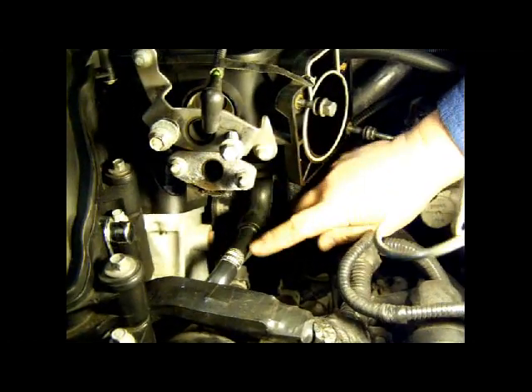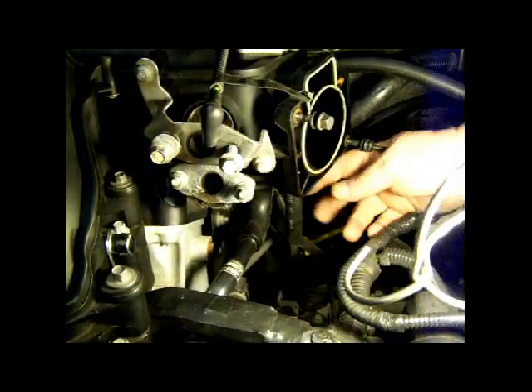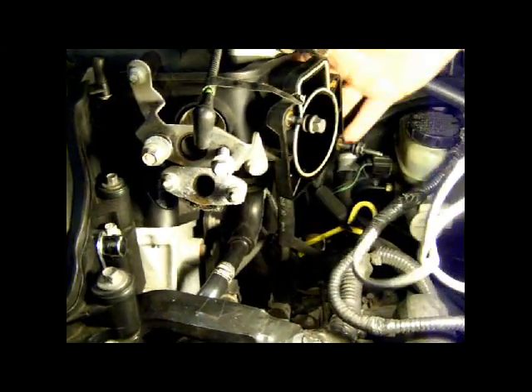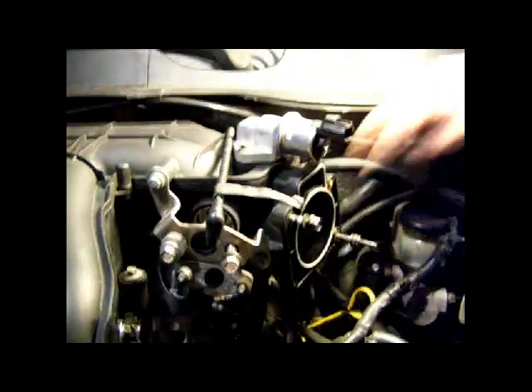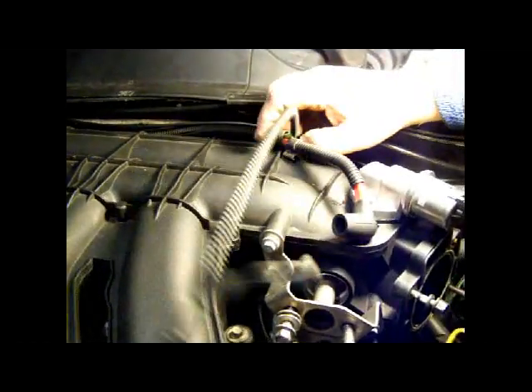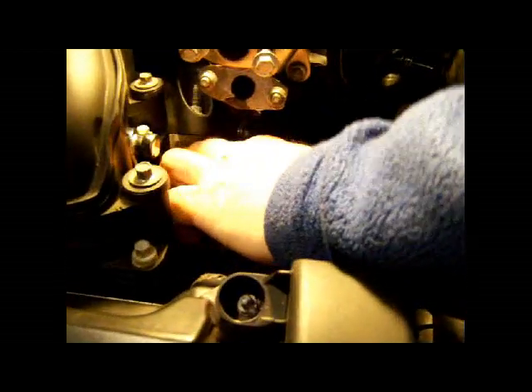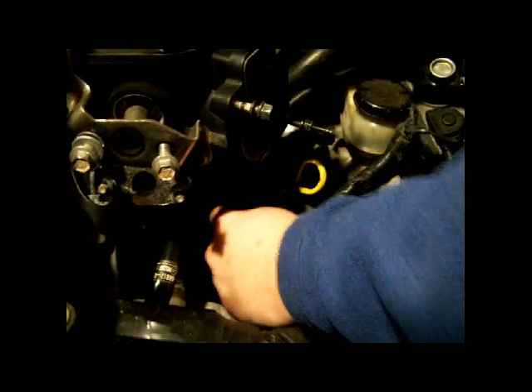We have some clearance now and can see what's going on underneath this intake. This is where the PCV comes in, so I disconnect it right here, separating the hose from this piece. I'll also pull this hose right here off the bottom of the intake. Around the back there are a couple of other things to disconnect — I'll pull this one off. I think that's some kind of sensor that goes with the EGR. There's another hose back here we can work off the fitting as well. That PCV hose comes right out of there real easy.